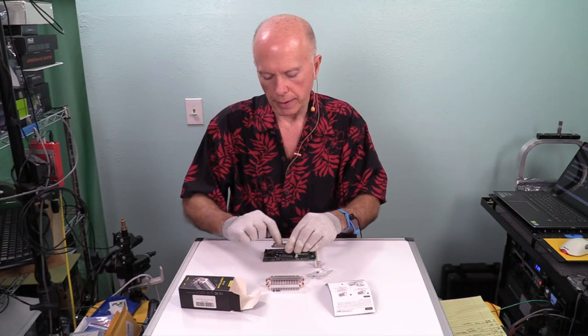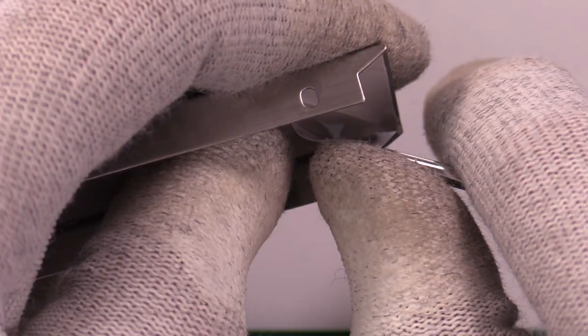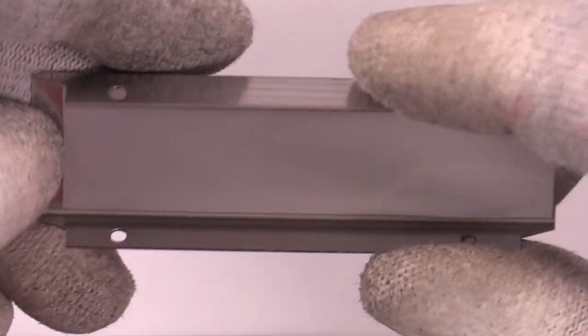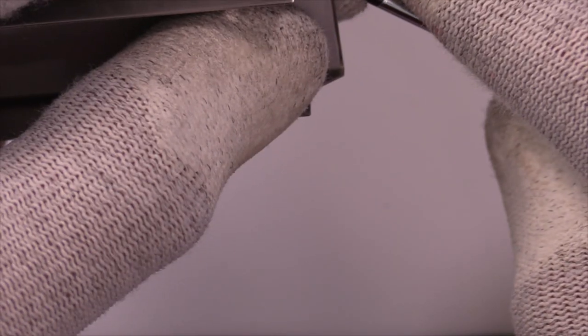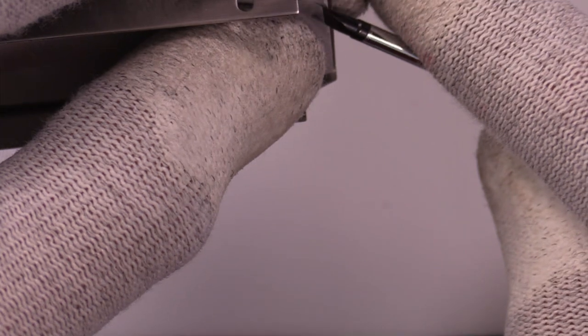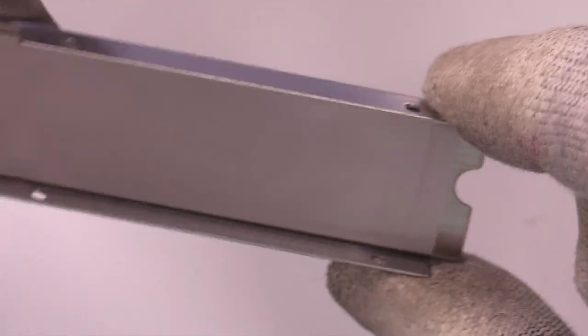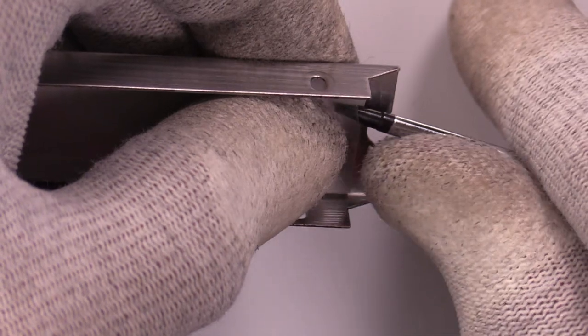And now I need to peel the top layer off the gray pad. Again, with a flat blade screwdriver, we'll grab the edge of that and gingerly peel that up. And that stays pretty good. It's trying to peel up, so I'm going to take a finger to that and just push that down, rub it down, and go at it again. Typically what happens when I do this, the pads seem to stretch a little bit. And because of that, I have a little bit of play on this end, but because of that stretch, this end where the notch is being the most crucial, I will instead peel from this end. So if the pad stretches, I won't have to reposition it.